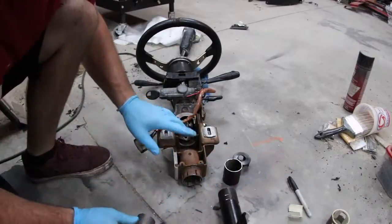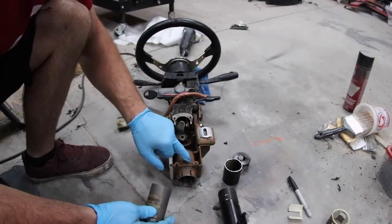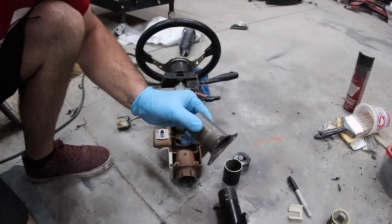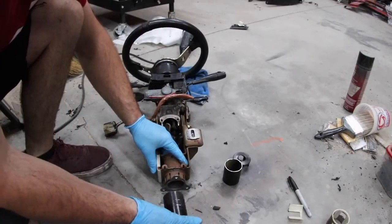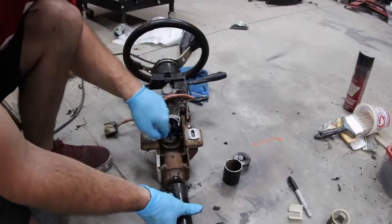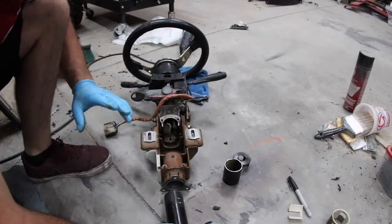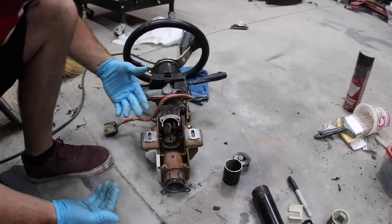I was a little bit wrong about the diameter but it's close. Ideally the best way would be to have this opened up by a muffler shop to whatever this ID is — make the OD of this pipe match the ID of this pipe with a couple thousandths for tolerance so it slides in and out. This is fine for right now because I'm going to bolt this to the power steering motor with the three bolts and slide it in and out — it can be maxed all the way down or come out this way. As long as I'm within 12 inches and 12.75 from here to here, I can move this inward or outward to fit the motor. I'm going to grab the motor, bolt this flange up to it, slide it in, and go put it in the car to see if we're in the ballpark.